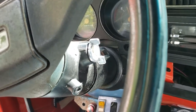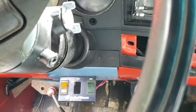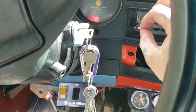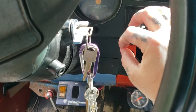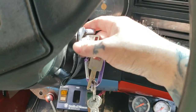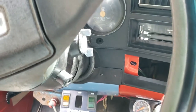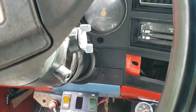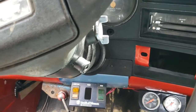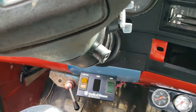I checked it out for a while and couldn't find anything — it didn't smoke anymore. So what I did was turn the key to the on position, found the solenoid wire under the hood, touched a hot wire to the solenoid wire at the starter, and it started up. I drove it home. That ain't fixing the problem — that's just a temporary fix. So let's get started. Hopefully you figure out what's the matter with yours by watching me figure out mine.